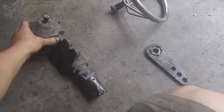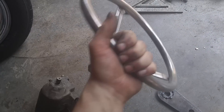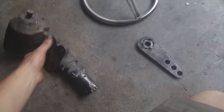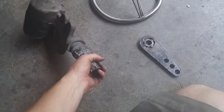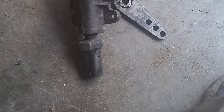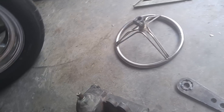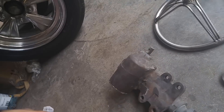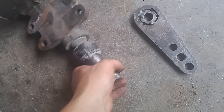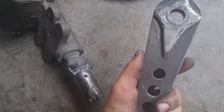Here's my homemade steering wheel, which isn't quite round, and it mounts directly to this steering box. The Nissan pitman arm — what's left of it — is right here. I cut it off and welded a three-quarter inch nut to the nut that holds the pitman arm. This is a piece of inch-and-a-half tubing welded to the pitman arm, and here is my steering arm that I made.